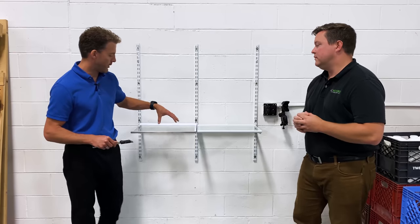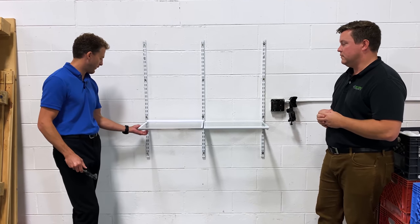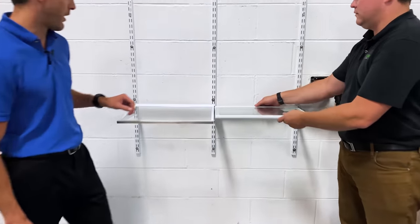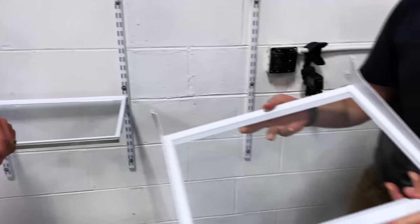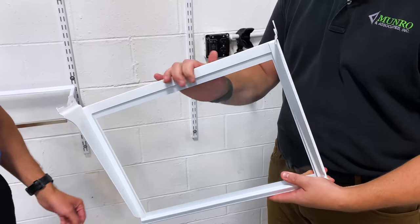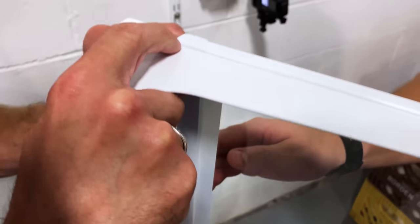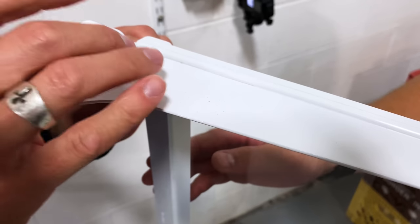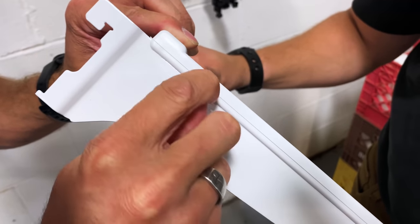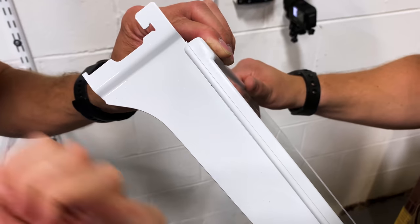So we've got the Frigidaire shelf here and the Sub-Zero shelf to the right. Both are made out of steel support arms, glass bodies that are encapsulated in plastic. The plastic secures each glass shelf to the steel support arm. So the Sub-Zero attached their plastic frame to the metal support bracket by overmolding. You can see a little bit of flash from where the plastic is shot and then encompasses the metal support arm. Odds are there's probably features in the top of the arm that the plastic can go into, whether it's holes or notches, to create a pattern for adhesion.